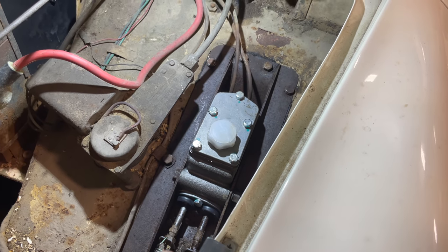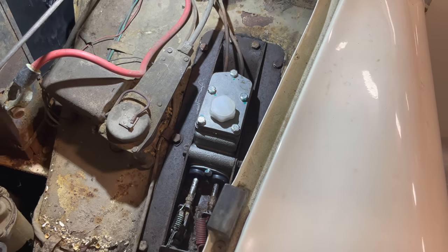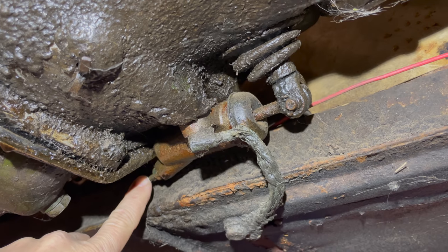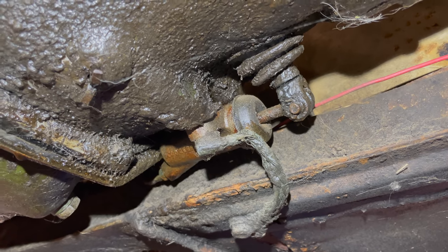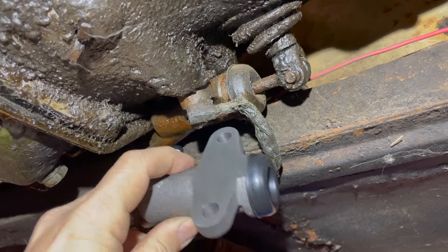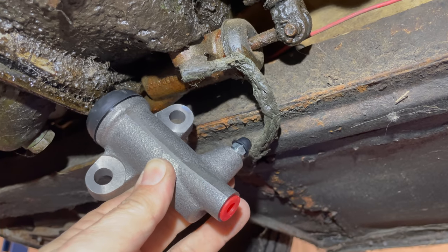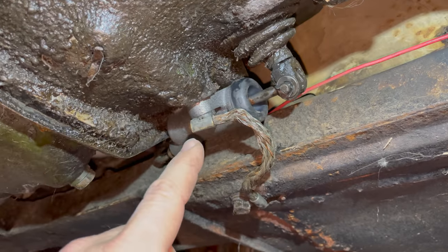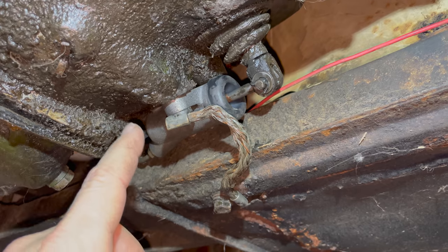That's the last of the work up here, besides filling the reservoir with fluid, which I'm not going to do until I fix the rest of the clutch and brakes. All the rest of the work is underneath the car. Just like the earlier Mark I Sprites, these cars use a solid line that comes down to the clutch slave cylinder — there's no hose down here, but there is a bleeder on the slave cylinder. Here's the new one — you can see the bleeder on top and the port on the back where the line from the master cylinder connects. I've installed the new slave cylinder and cleaned everything up.